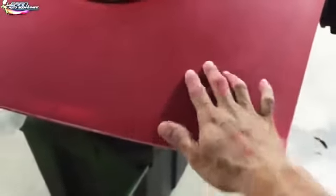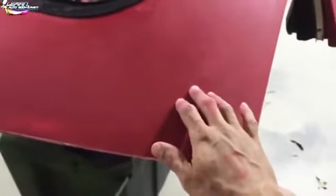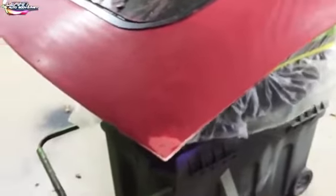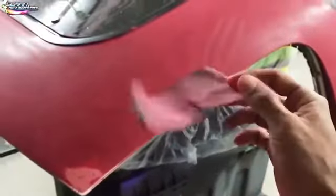Taking a closer look, you can see all the chip marks in the corner sections and edge areas. All I did was water-sand it with 400 grit. If you've gone through this course you know the water-sanding process — I'm not recording the sanding itself here. I used about two quarter-sheets of 400 grit and wet-sanded the whole thing down nicely until it was smooth.